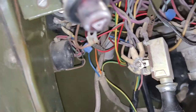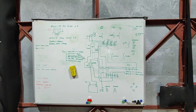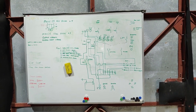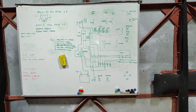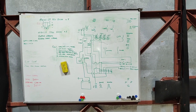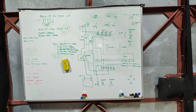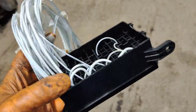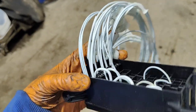Basically I've got to get rid of all that. I don't enjoy wiring - I can get through it, I think I'm pretty methodical but I'm not very quick with it. Anyway, I've drawn up a circuit diagram with fuses, relays, etc., so I sort of know what I want to do. Over the last few evenings this is what I've come up with. I've wired in a headlight relay which is there, and for the fuses I have from right to left: sides on one fuse, side gauge lights and hazards - so they'll be on with the ignition off.